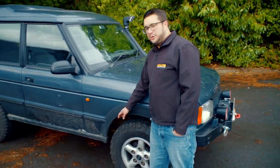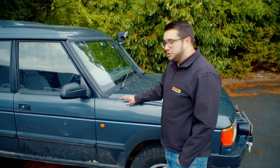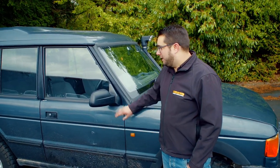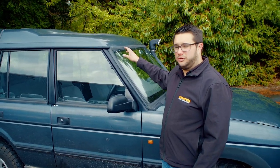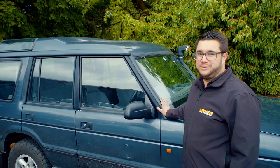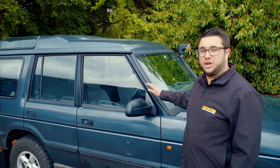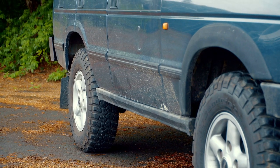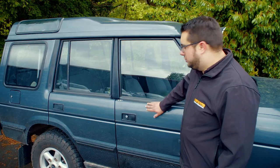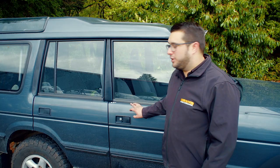Moving back, lower sills, outer sills and inner sills rust really badly, as do the bottoms of door pillars on the A pillar and the B pillar. If you've got a vehicle with twin sunroofs like this one, chances are they will have been sealed up because water lashes in through the top, sits in the carpet and sound deadening, and then rots all the floors. Moving down the vehicle you want to be checking for any significant damage. Scratches aren't too much of a problem if you're going to use the vehicle for green laning or off-roading.